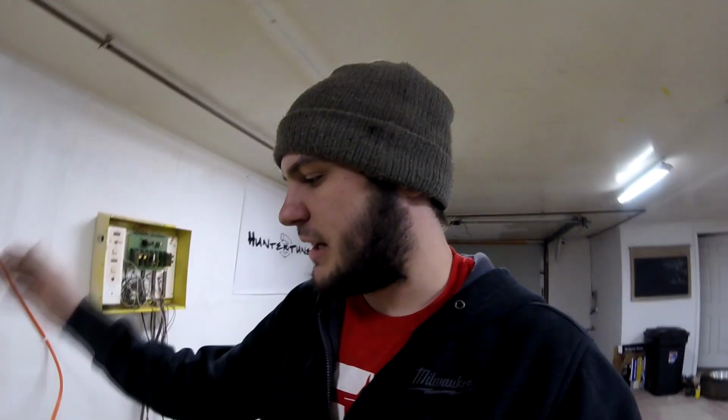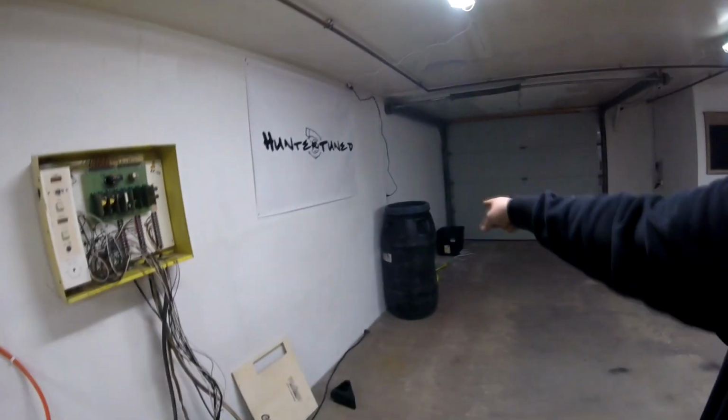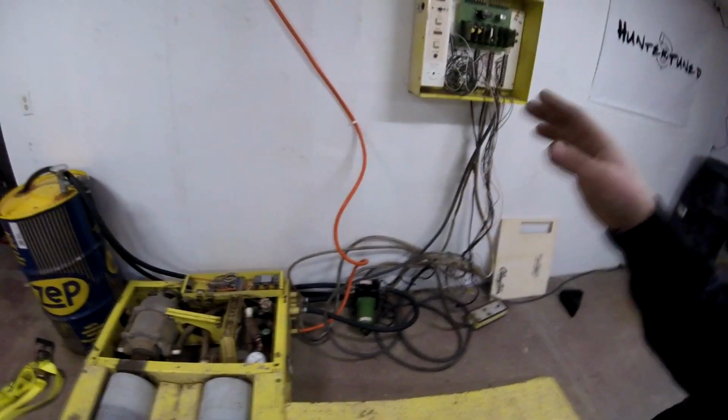So what I would like to do is kind of flush the dyno out, all the old water eventually, probably sometime this week I'll do that. And then run good clean water through this one with antifreeze, so it will be sort of lubricated as well, because antifreeze can kind of help lubricate some parts and whatnot. So I think that'd be good for the whole system here to give it some longevity.